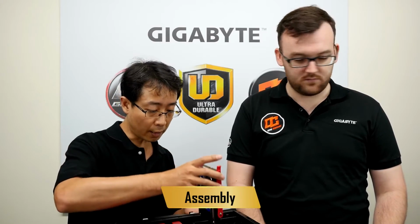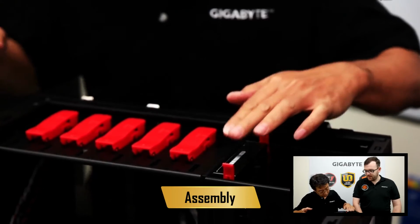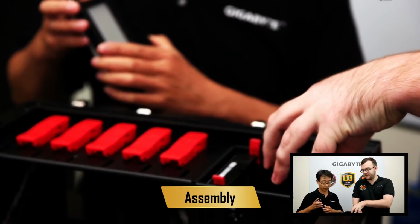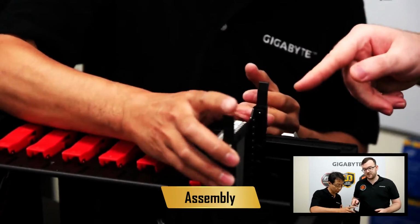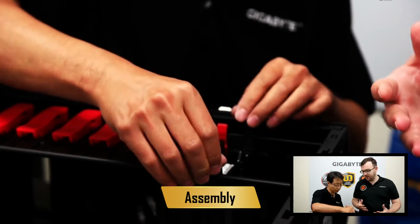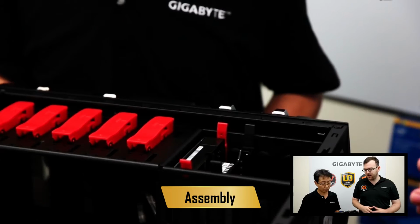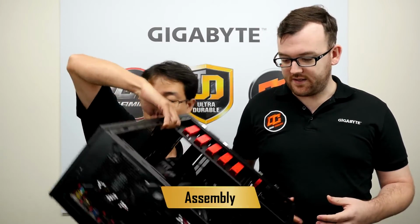So we just slide the hard drive in. Yeah, so in the chassis. Exactly. So in our case, it comes with a nice space for all the drives. In this case, we do have these mounts on the drives on the side, and so they will screw into the drive, and you pop it in there, and you hear a nice click, and you'll know it's securely in the case. Okay, so now it's time to connect the cables.